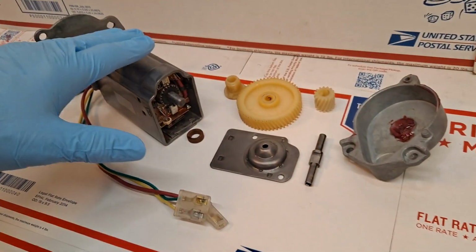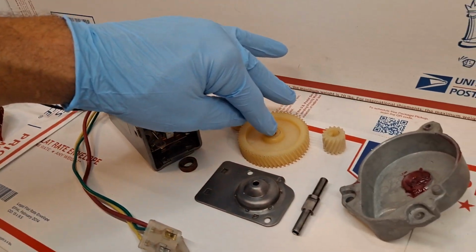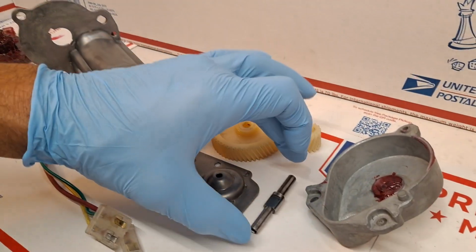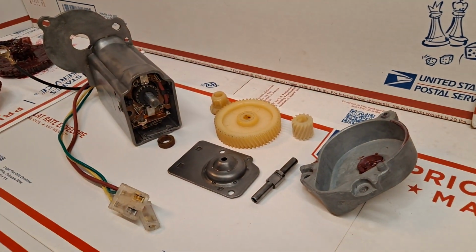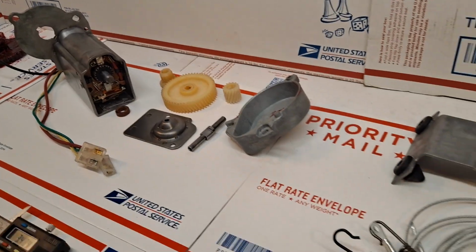Included is the motor, which has been disassembled and rewound. And I've gone ahead and changed out the primary drive gear because there was wear in the center area where the spindle engages. So we'll have good seal integrity in terms of the spindle and the drive gear. And these will be going out to my friend Scott as soon as I get his okay to ship.